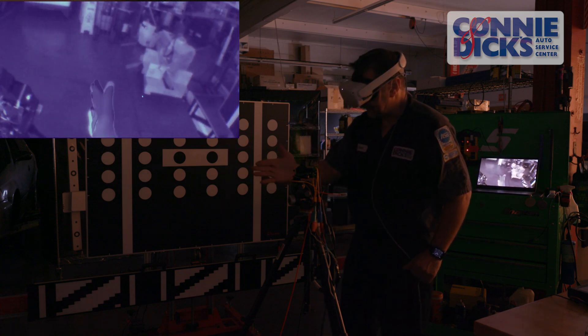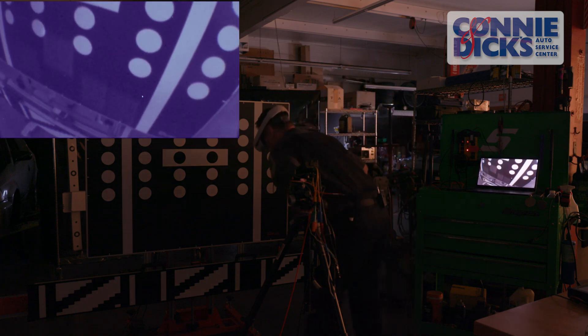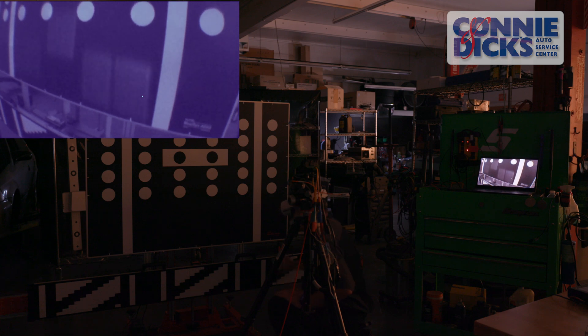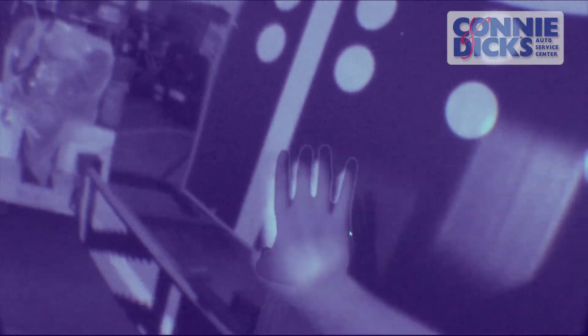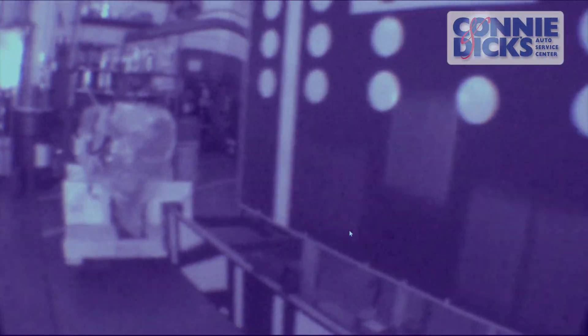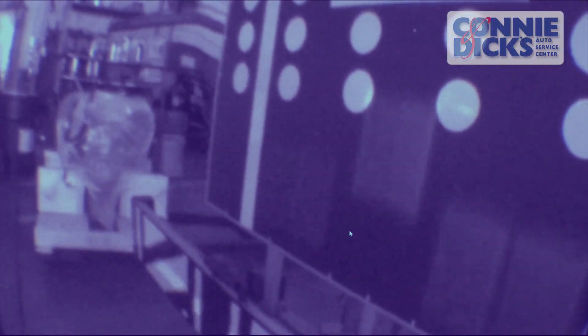This sensor is outputting a pattern you can see on camera. We have two blocks on the right and center with a little line separating them, and two more blocks on the left. These are scanning the area right out in front of the vehicle to detect objects, pedestrians, and vulnerable road users so the vehicle can take proper corrective action.